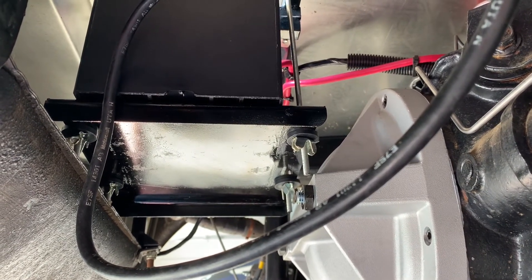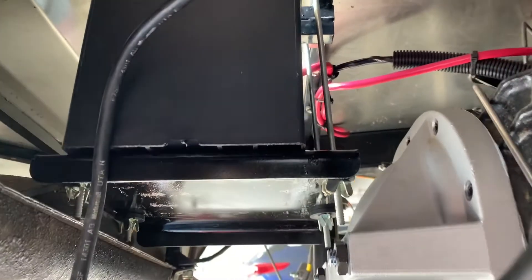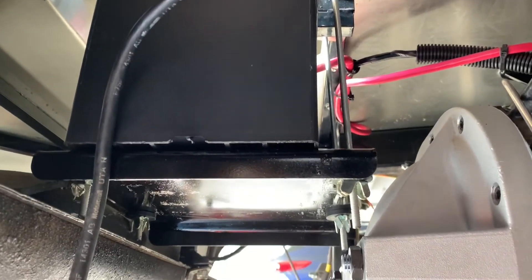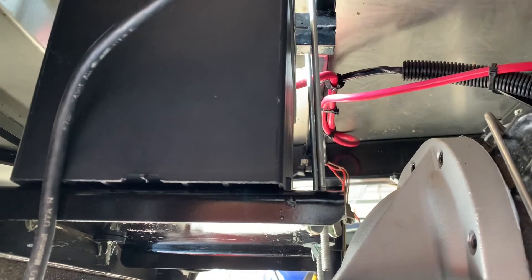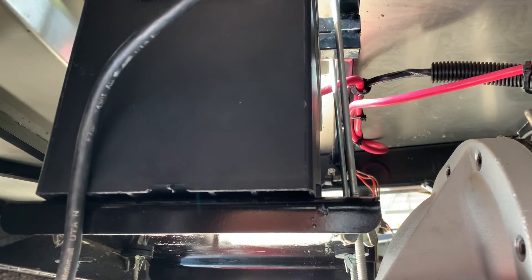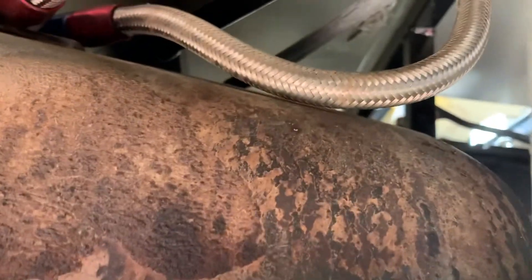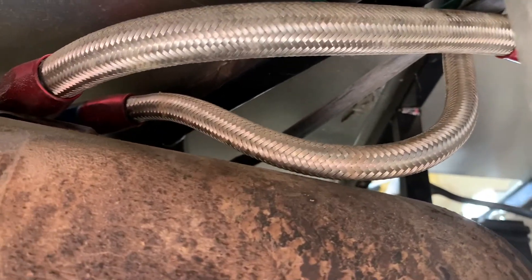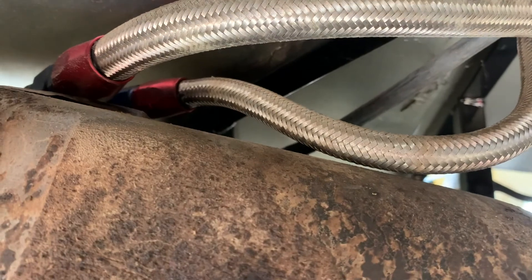As you can see here, this is what I was talking about with the battery tray clearance — those studs I've already cut down are still pretty close to the diff cover, and I really can't cut them much more or I'd never be able to get the tray on to remove the battery. That's why I'm thinking this is not going to work. I need to cut my losses and mount the battery elsewhere — up under the trunk floor. There's a nice cross brace under there I should be able to bolt a tray to, so I just need to measure the battery and get that figured out.